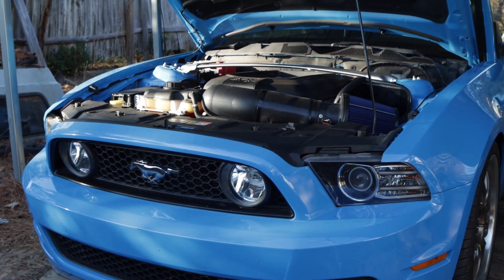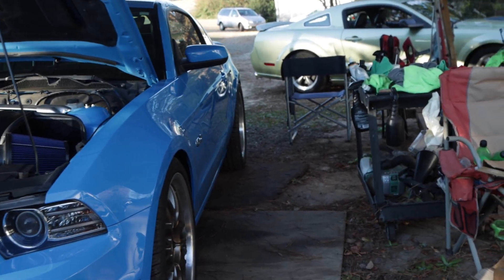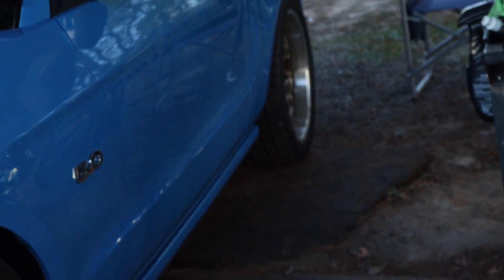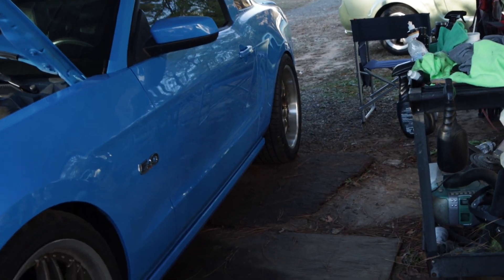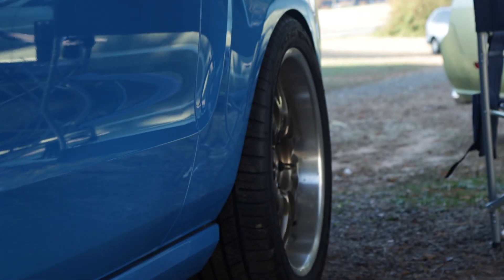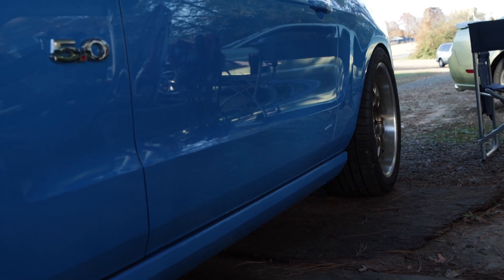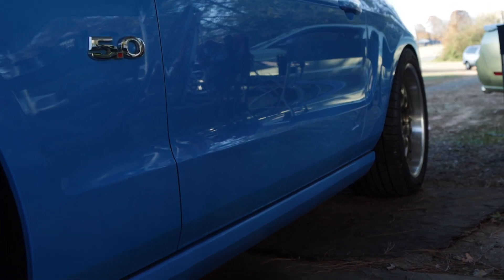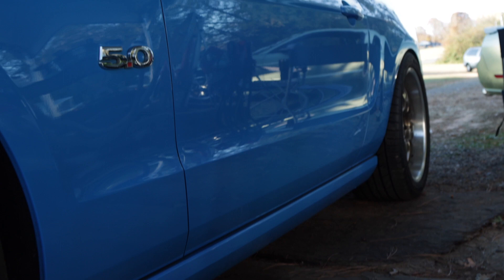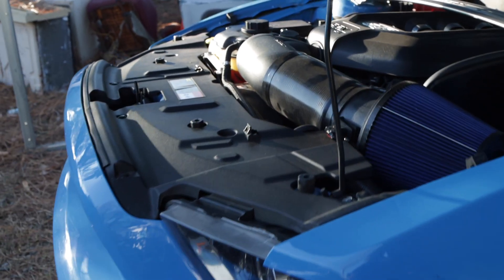That's really all I have on this one — a caster camber plate upgrade and we adjusted the panhard bar to get the tires more flush. That tire is massive — it's a 305. It does help with traction somewhat, but it still tries to blow them off. This will also potentially help the car get a better ET, because instead of pushing the front tires it'll actually be rolling. Every little bit helps in an eighth of a mile.